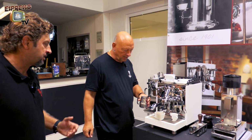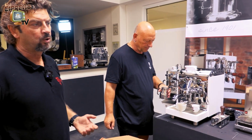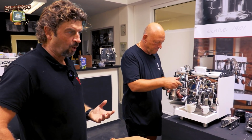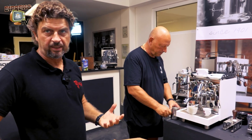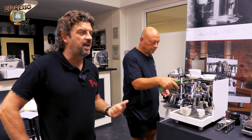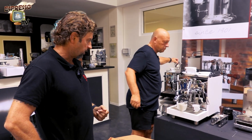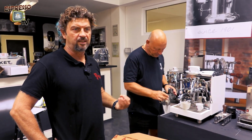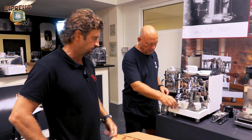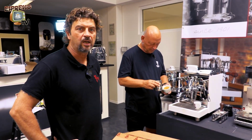Also in terms of steaming capacity, our machines of this range have a 2-liter boiler that allows a very good steaming capacity. The boilers are in copper. Copper is the best material to keep the heat and to keep a stable thermal condition of the machine. Besides that, it is one of the healthiest metals in contact with food. The important thing is not to put acid into the hydraulic circuit because you can damage it. We recommend the descaling to be done by a professional with an ultrasonic machine.